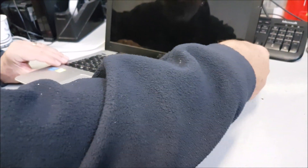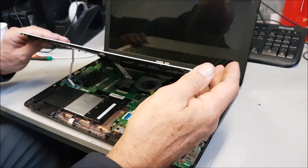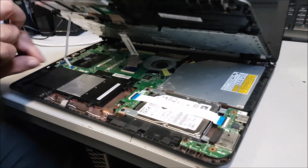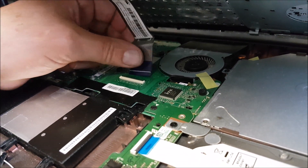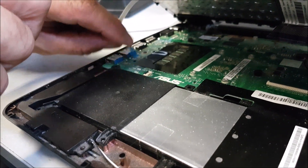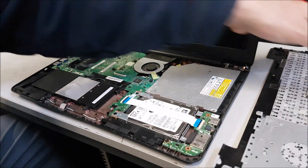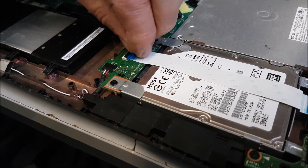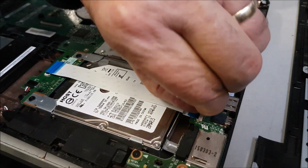What we're going to do is change the hard drive. I'm going to pull the clip back. With these, what you do — can you see that in there? Just lift this little tab up like that, that will come out. And this one here, you just pull forward and that pops out, freeing the keyboard. Then here, same one — just lift the tab up. That disconnects the hard drive from that. You can leave that on there, or do both sides if you want to.